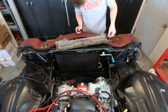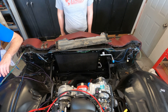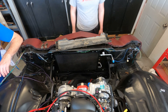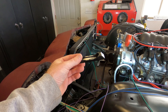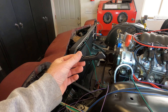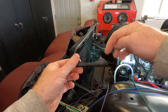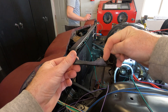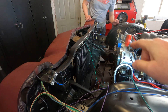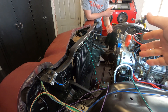Spacers. They don't really pop in, they just kind of sit there. We've got these brand new polyurethane radiator support bushings. They should be an upgrade over the stock rubber ones, but instead of ending right here where my fingernail would be, they continue out here and hang over the lip of the lower radiator support.